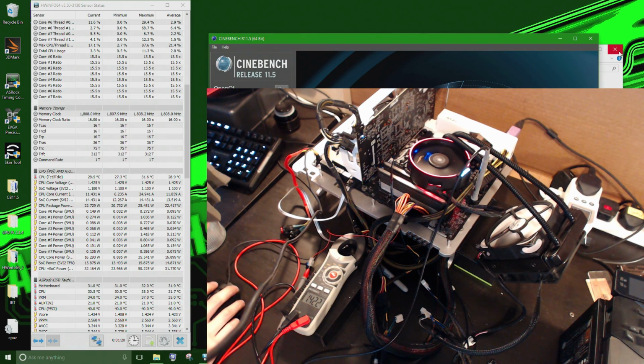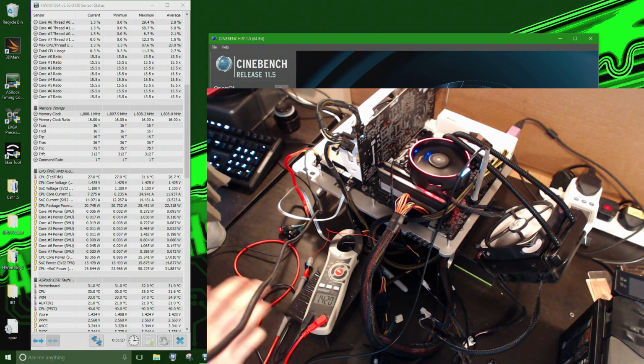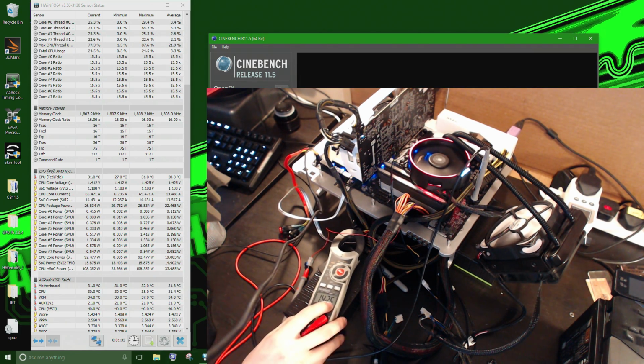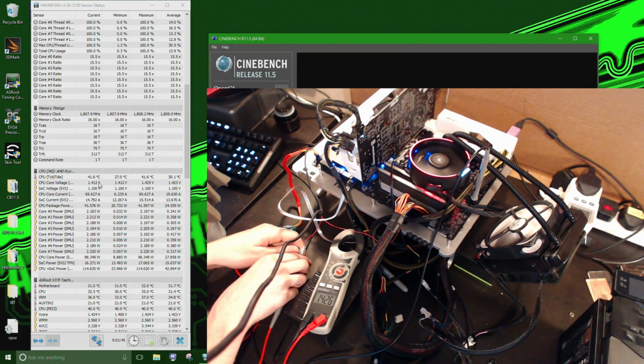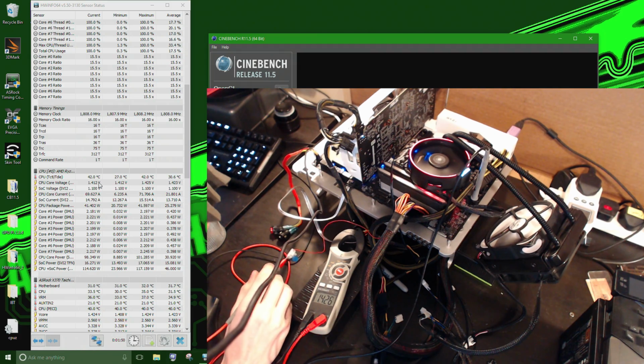And these settings aren't fully stable, so it might crash. But there, we can see right now we have 1.42-ish on the back of the socket, and then when we press run, it actually boosts up. I had 1.425 set in the BIOS, so right now this is reading 1.426. In OS, we're seeing 1.412. So this is very, very close to legit readings. They're really, really close together. So at this point, I'm going to trust them.